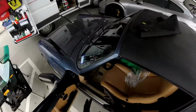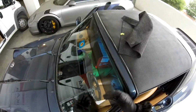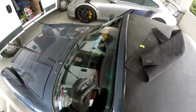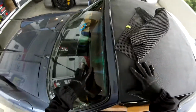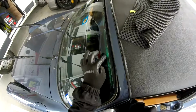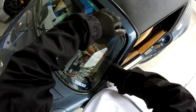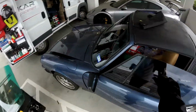Good retention is when I snap it with my hand or tap it and it's not gonna come off. This one came off because it doesn't have too much seal. So that's when you put the seal. You have to prevent the glass from being thrown out of the car in an accident, because this one doesn't have really good retention, it's just the gasket. Of course the gasket plays its part too, so it's not just the glass. But in case the rubber is still in place, the glass has to stay in place as well. That's why we gotta use the seal.